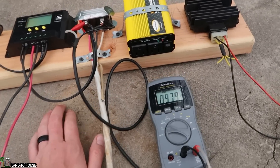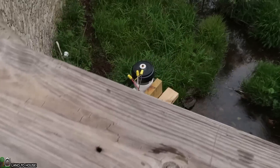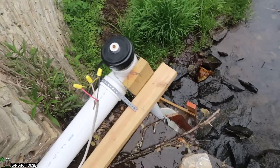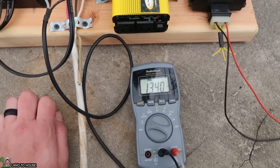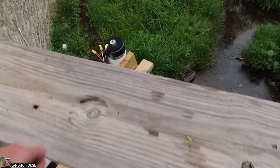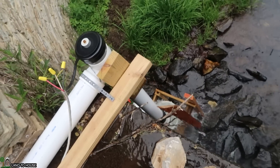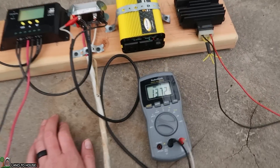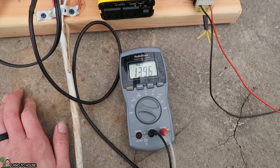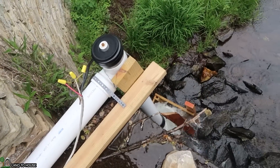Man, that's going real slow. Yikes! 10 volts. I thought it was way off. This is unloaded, so there's 13.4, 13.5. I'm going to assume that by now there is no more air being sucked up from the intake. We've got 13.8, 13.9 — I saw a 14. So 14 volts — probably not enough to charge anything once it's got a load on it.